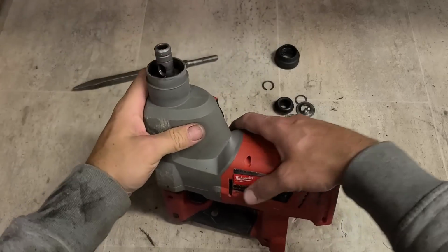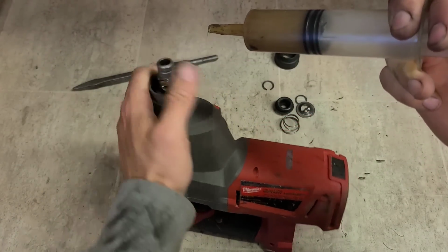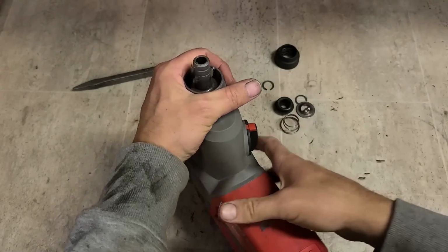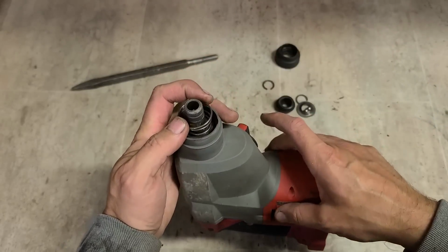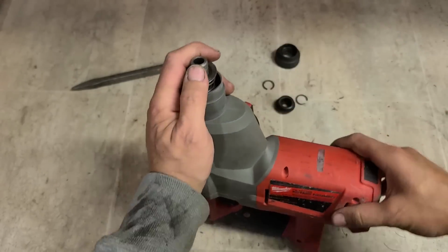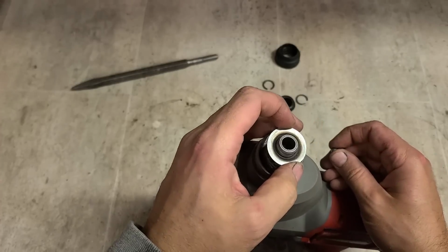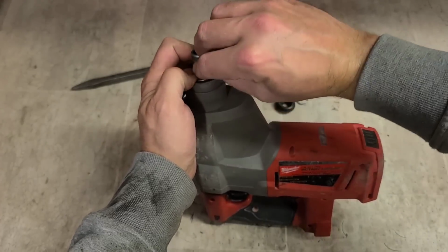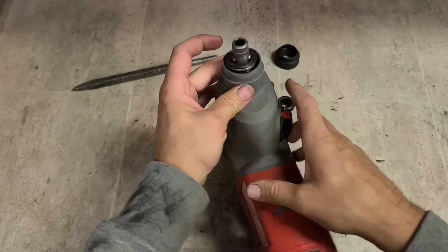And it could not be easier to fit. Bit of grease. One to hold the balls and two to keep it lubricated. Just a wee dollop. Your spring goes on, narrow side down. And this little sleeve. Sleeve is actually holds these steel balls. Drop them there and there.